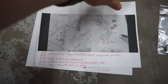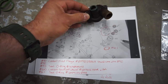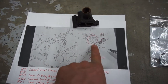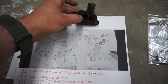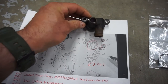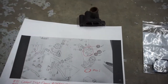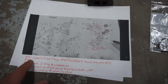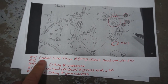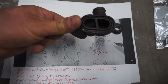So what we have here is the coolant inlet valve — whatever you call it. It should come with an o-ring, or the seal on the bottom, because you will break this piece removing your EGR cooler. You do have to order this o-ring, so you order this part which is the coolant flange — that's number 41 — and that's the part number right there.